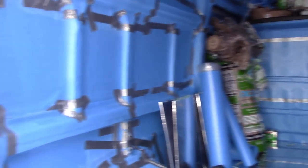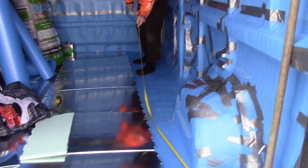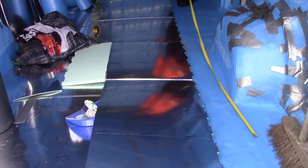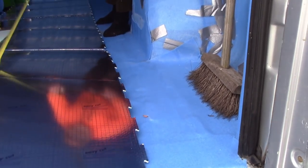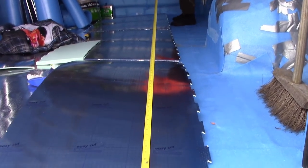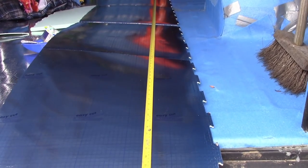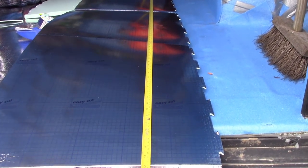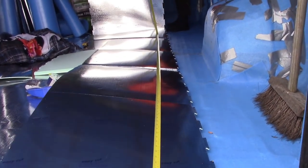The entire inside surface of the van is now covered in the blue polyurethane foam. This is trimming up the final floor panel. The floor's been covered in the blue foam, so that's a continuous sheet of foam that goes the whole way around the van. There's no exposed metal now, and this foil-backed insulation is going to go on the floor, on top of the blue foam, and then the original ply floor of the van is going to go back down on top of it.